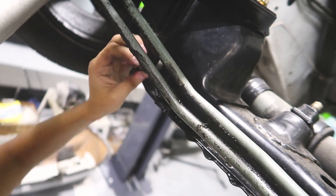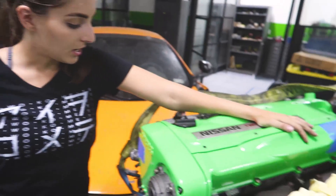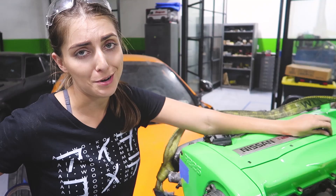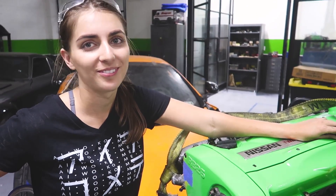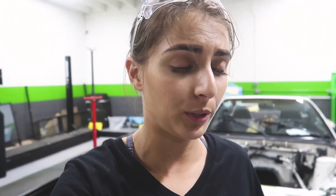It's official because we brought the hoist out. Right now I am putting tape on the pretty little green covers in order not to scuff them up since they are not ours. The main reason to put the RB26 in the S13 is so that I can mock up the downpipe, which is also going to include the elbows, while we just wait for the end fittings. We're really close to being done with this — once the downpipe is mocked up, I'll probably pull the engine just to finish the turbos, and then we're good.